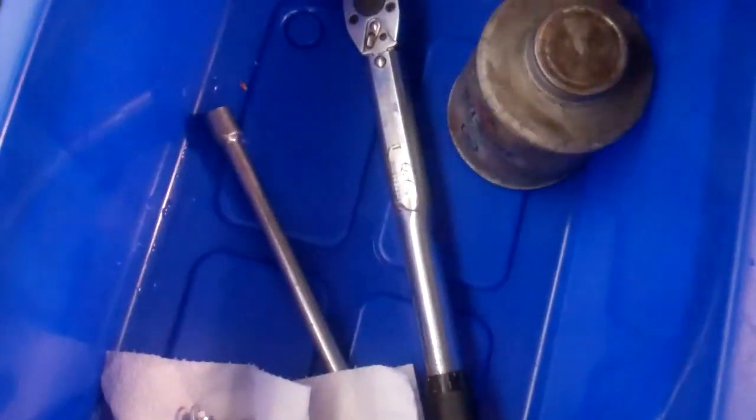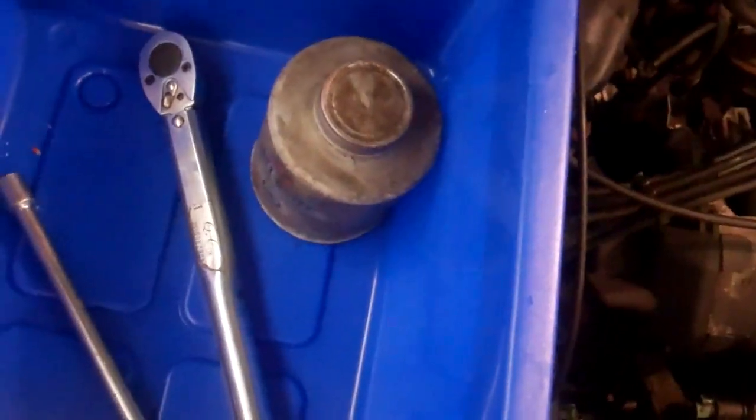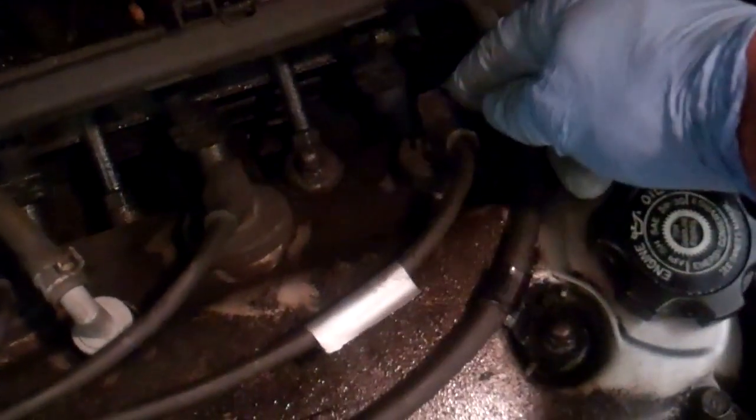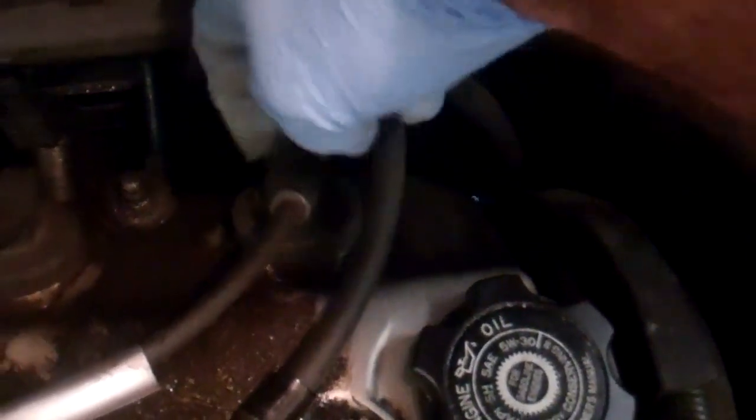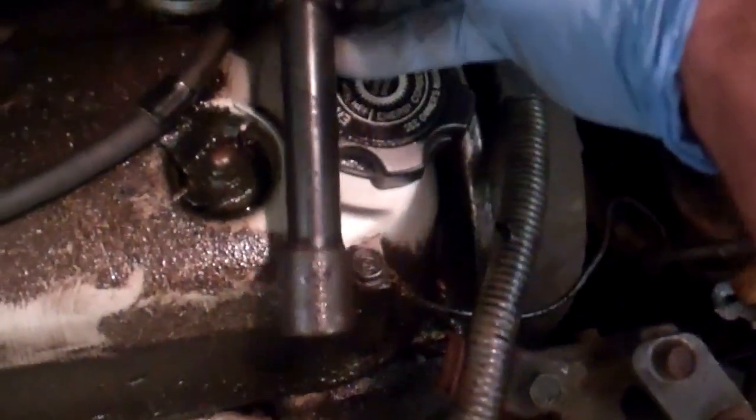Then always take a little container so you don't drop things down into the engine — put everything you'll need in there. There are your spark plug wires, and in this case these ones have the end of the wire going probably four or five inches down into the motor. So I need an extension on my ratchet. When you go to take them off, just twist them gently to release them from the plug and pull it out. As you can see, that's how long it goes down into where the spark plug is — that's why I need the extension.